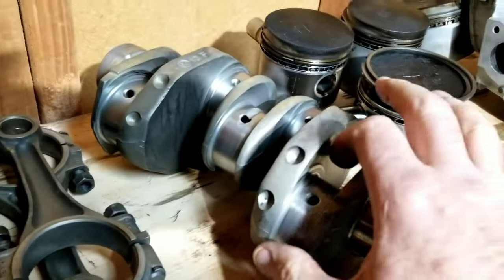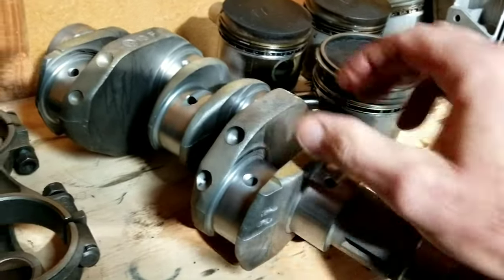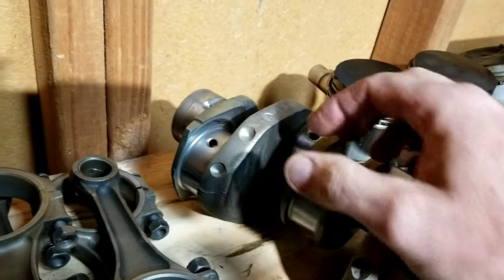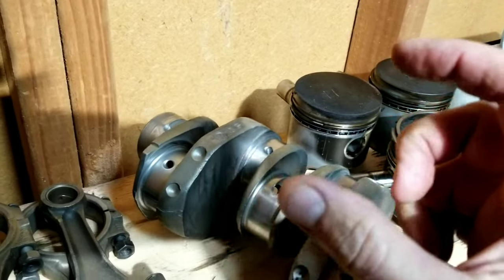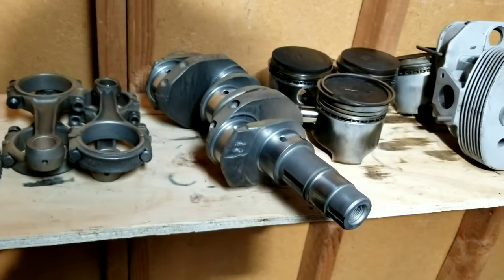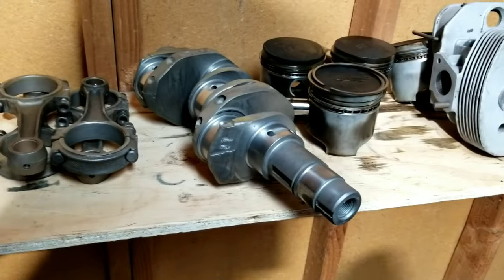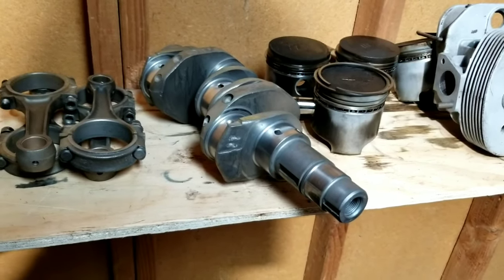We also checked the crankshaft here, and checked it all the way around each journal and made sure it's within specification for run out. If it's too wide and then too narrow, there's too much in there, then that crankshaft needs to be machined. I'm just saying for your situation, maybe all yours needs is a crankshaft from Craigslist or this type of cheap poverty rebuild.